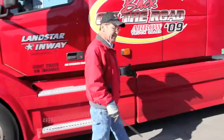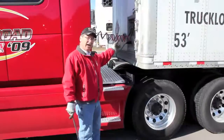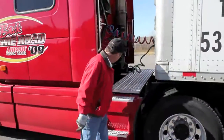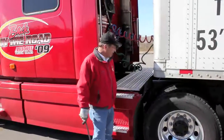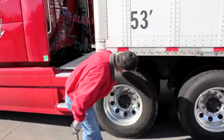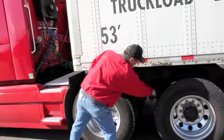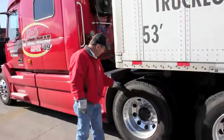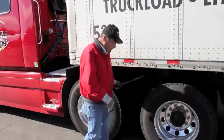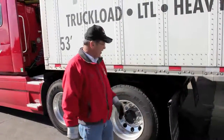My first stop when I start doing my pre-trip is right here at the beginning of the trailer. I'm going to check my airlines, make sure that they're still hooked up and that they're hooked at the tractor also. I check to make sure my fuel caps are still on my tanks. I move into the tire area and look underneath to make sure that fifth wheel pin is shoved in, then I'm going to thump my tires and inspect them to make sure there's no rocks, bolts, nails, or anything in my tires. If there's a rock, I can just take my tool and flip the rocks out to keep them from hitting somebody's windshield as I go down the road and the tires flex.